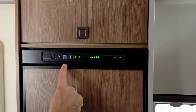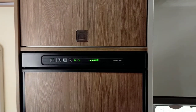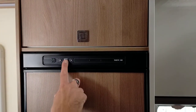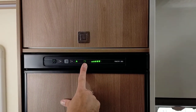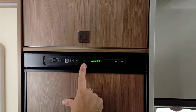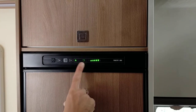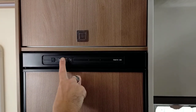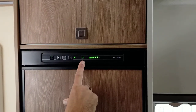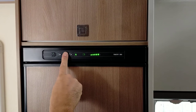Now, if you have selected automatic and you're driving — which will display as automatic on battery maintain — and you pull into a service station or a shop and you may have accidentally left the gas on, there is a 12 minute stand-down before this unit will move over to gas. So don't be concerned — it's not instantaneous, but only from battery to gas.